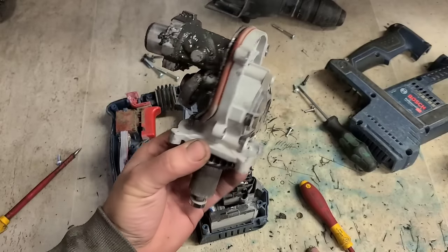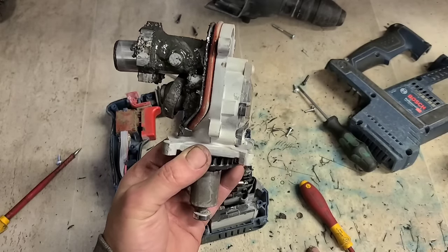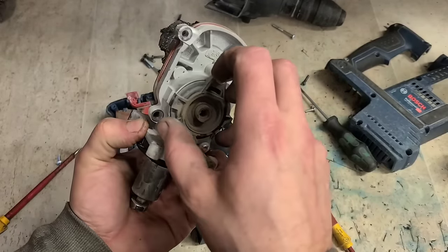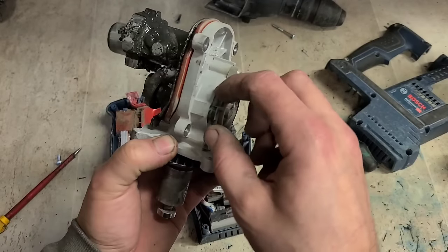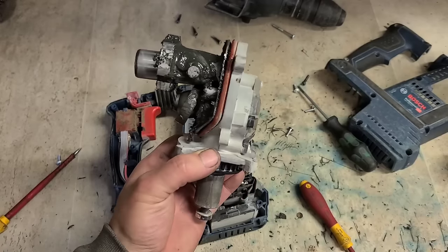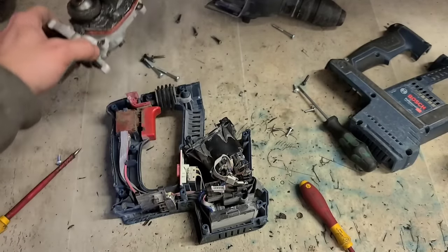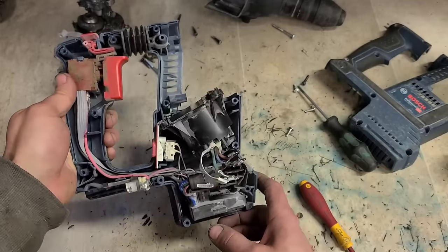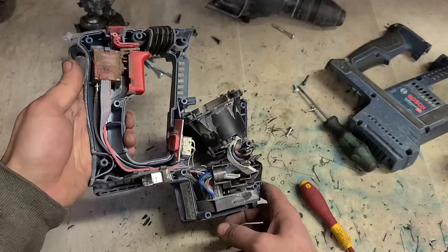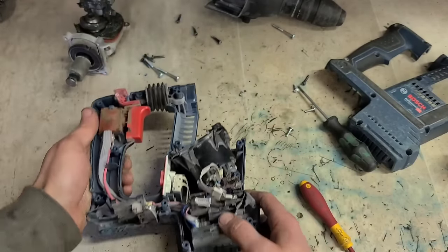That there, housing there. It's not exactly the same, but it's the same sort of setup as the old Bosch 4 SDS drill. The old style one, with the actual bearing plate on the back, the bevel gear being driven off the rotor. Which was a very good machine and a very good setup. That there, I've no doubt, will be just as good. Like that setup. But motor-wise, it's nice to see they had these here separate. If they didn't, wouldn't be recommending this. But seeing as they do, have to say, that's a good job.